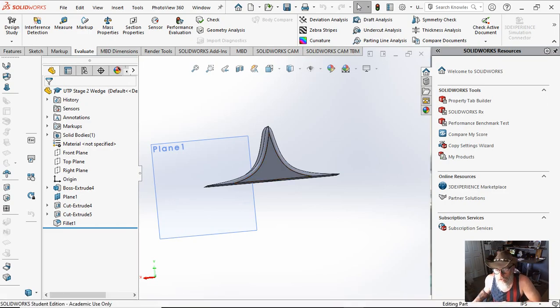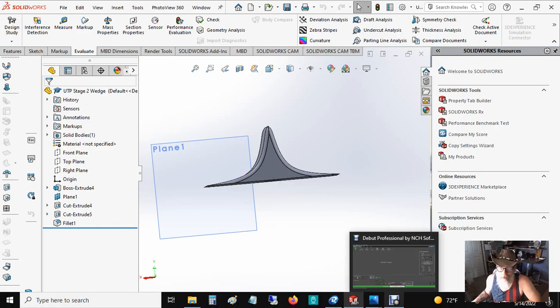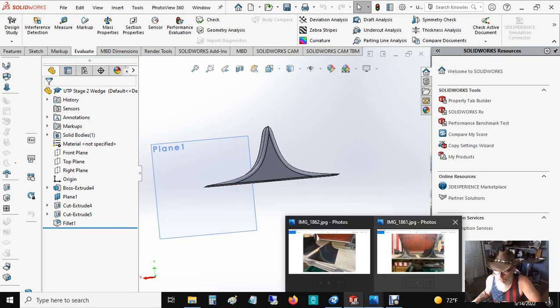But for the guys that want a few more horsepower, some more CFM to feed inside of there, number one, you can remove the wedge completely and get all of the airflow in there, or you can lower this, keep some of your torque that you've gained below 3,000 RPM, and at the same time gain another 10 to 12 horsepower on top of your old configuration at the crank. Obviously not at the wheel, but anyway.